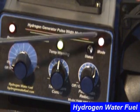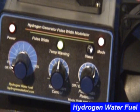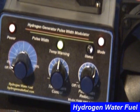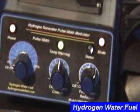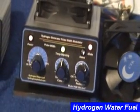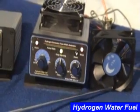The mode light, located in the upper right-hand corner, is also used to monitor and assist in the PWM hydrogen production. A 12-volt output is located on the back of the unit, which you're not able to see, and it can handle up to 8 amps. When the temperature indicator light comes on, 12-volt DC is supplied to the terminals on the back of the unit. This can turn on a pump, which can circulate the water through your hydrogen cell until it cools down. We currently have it connected to a fan so that we know when it is activated.